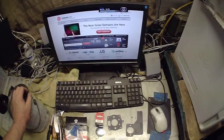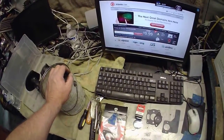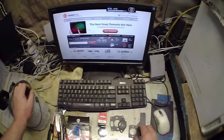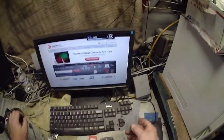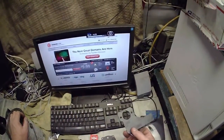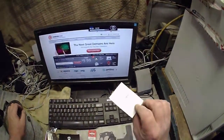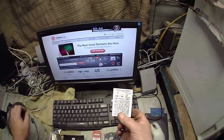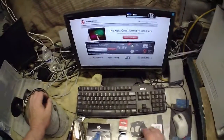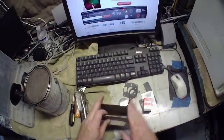I'll save that for the future. It gives me that gasket and that gasket, which I needed. This gasket I ordered because it goes between the intake manifold and the engine block - I'm going to take the intake manifold off, clean it, and maybe polish it up. No idea what this other piece is for - I'm guessing it's for a different carburetor that has nothing to do with this. The float level information and needle seat information are there too - all very cool, I wasn't expecting this.